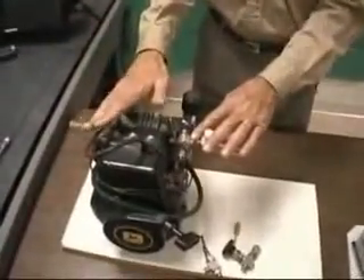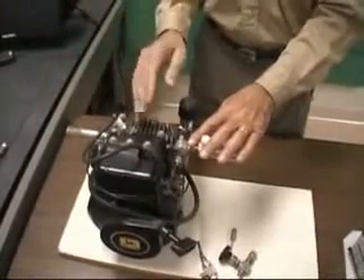Wouldn't performance automobile shops carry some of those parts as well? Yes, a lot of them carry a variety of different brand-name ignition control systems. They're usually for engines burning slow-burning fuels such as gasoline or methanol — for those you'd have to advance timing. But here we're making it so that we get much higher thermal efficiency and much greater use of the fuel, producing more power than before by making a later ignition, because we have a much faster-burning fuel.